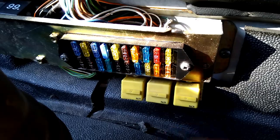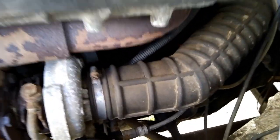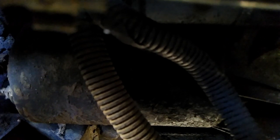The other option is the solenoid on the starter motor could be duff, so you could try taking off the turbo hose on top of it and then try hitting it with a blunt object — a piece of wood or something — while it's being cranked to see if that will free it up.